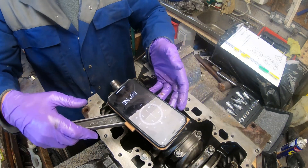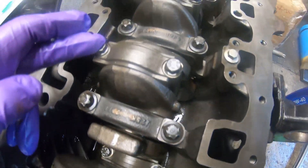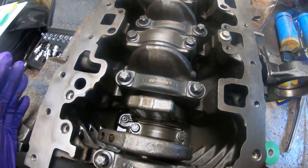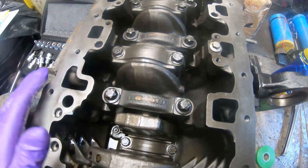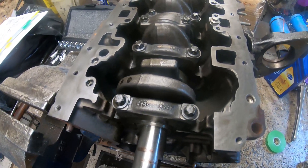Job done — 55 degrees. I've torqued all the mains and big end bearings using the same methodology. As long as you hold the engine still and tight without wobbling it, if you make a mistake just re-torque them down and take your degrees again in one nice steady motion. That will save you the cost of a very expensive dial gauge. Hope you enjoyed the video.